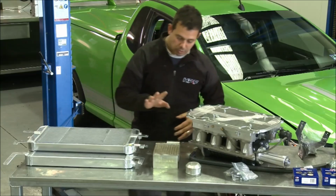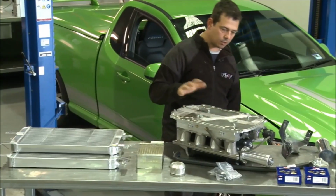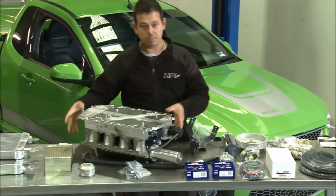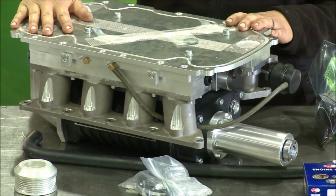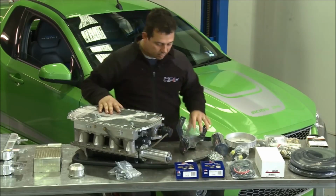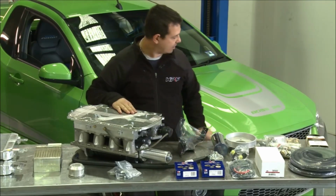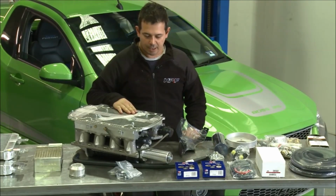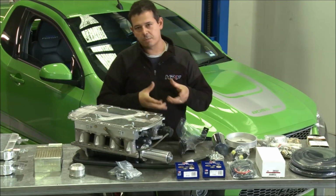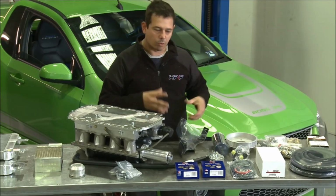So we've got that. We've got the intercooler, which is actually going inside the blower kit, so I'll dismantle all that, get the intercooler in, make sure it's all sealed and finalised, and that will basically take the place of the intake manifold. You take the intake manifold off, you drop that on, and away you go. It's nice and neat. Look, my preference would be twin turbo. I love my turbos. Did that to the BA turbo. Only problem is because the engine's got such a wide V, you don't actually have the space to fit turbos where would be ideal, which is beside the engine. So what we had to do was mount them up the front.